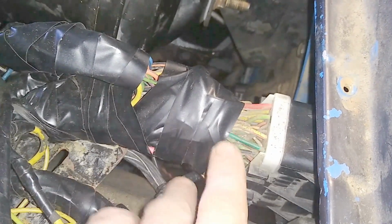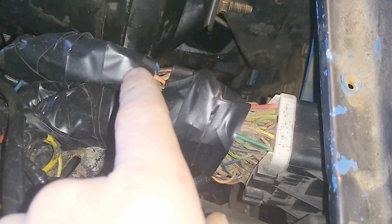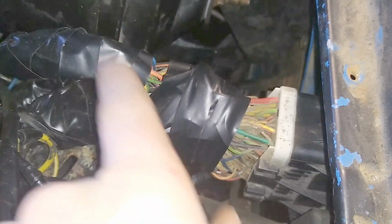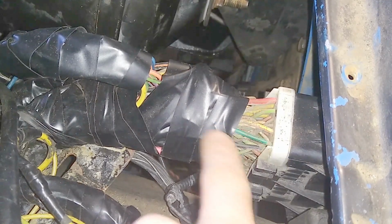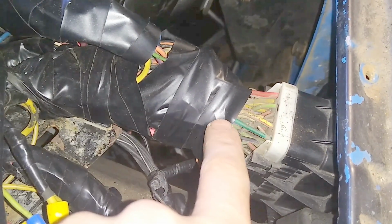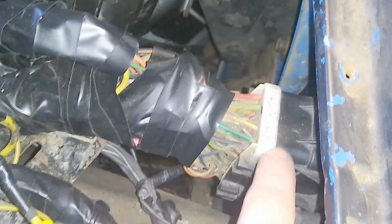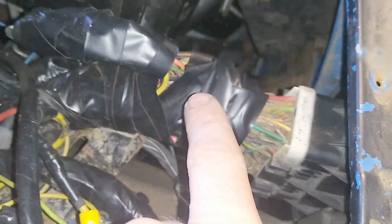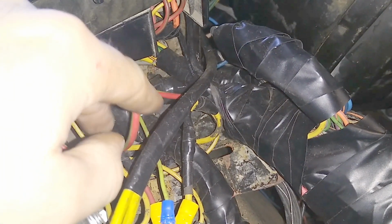It took a little bit of figuring out, but basically any wire that's not being used, you can cut, and then you can continuity check it on the other side and figure out what color wire it is. They're all the same color on either side. So like this green wire is the same color on the other side of the breakout connector. So it's not too hard to figure out, but if you're trying to find a wire that's spare, I'd recommend doing a continuity check.